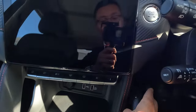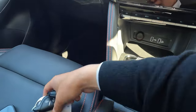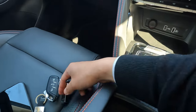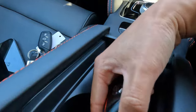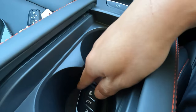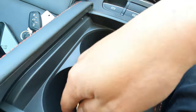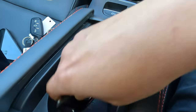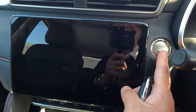When you're inside and the key is working, simply put your foot on the brake and press the start button to start the motor or engine. If your key battery has run out, or if you're in an area where the signal is blocked, place the key flat over the sensor on the key card holder, then put your foot on the brake and press the start button — the MG logo works from either side.